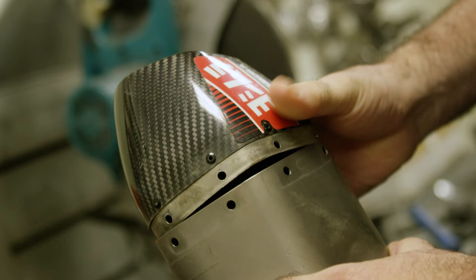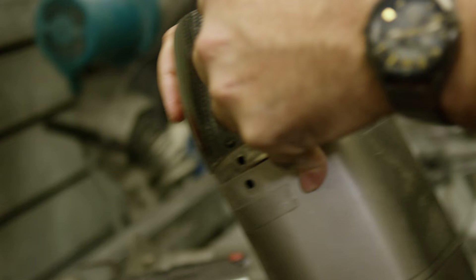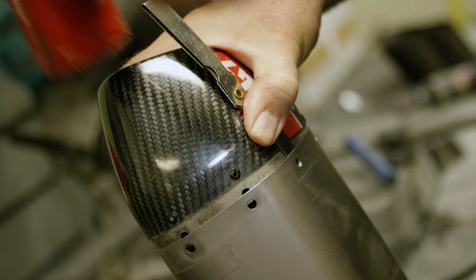The hardest part is getting the end cap on. The end caps and the canister edges are very sharp — be careful not to cut yourself or damage components. When putting them together, take your time, use the soft-face mallet, tap it in gently. When it gets tight, you can use a couple of tricks: feeler gauges can be used to wedge and cheat in some of the tight corners.